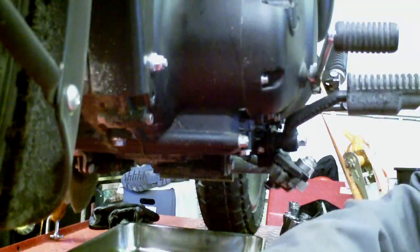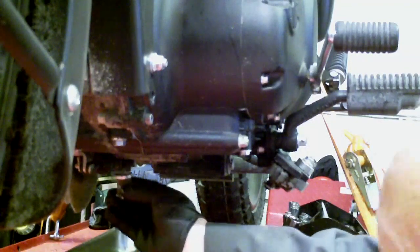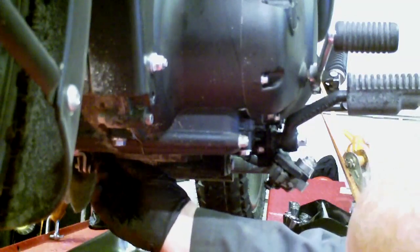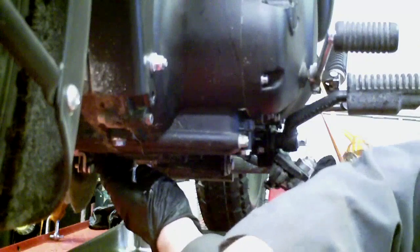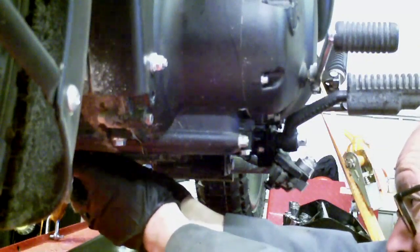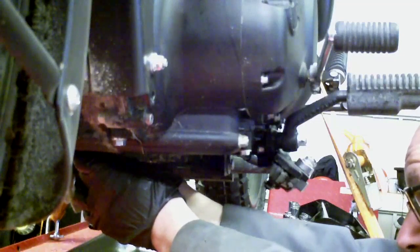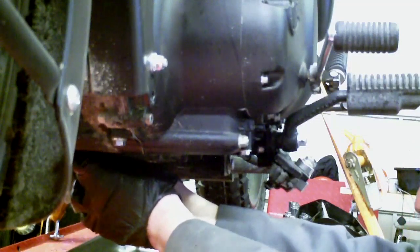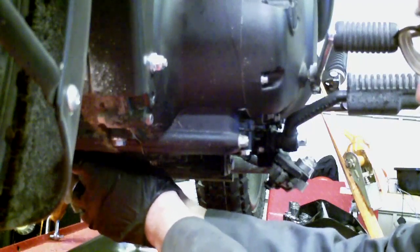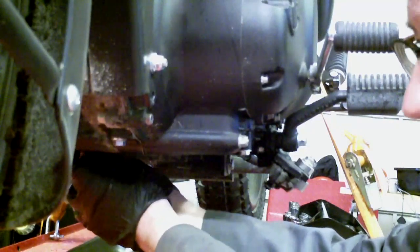And the gauze filter tube. Slightly awkward because it's so upside down doing this. The sealing plate with an O-ring goes over it. These bolts are 8mm, and again they really weren't tight.